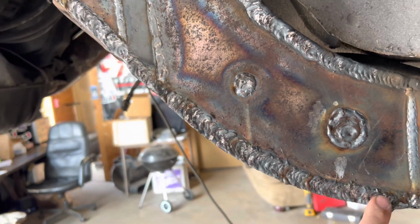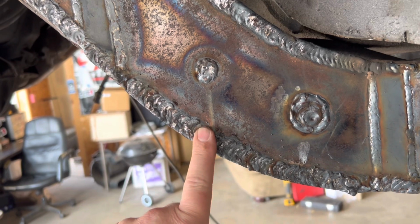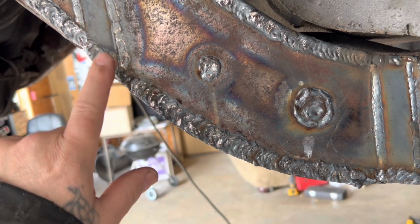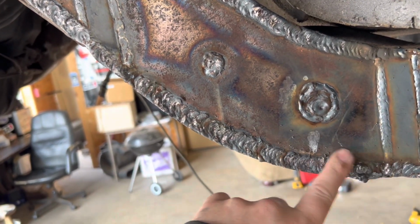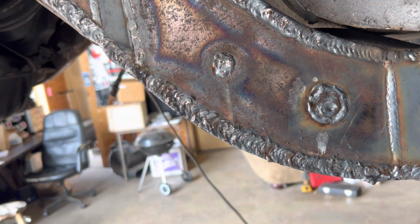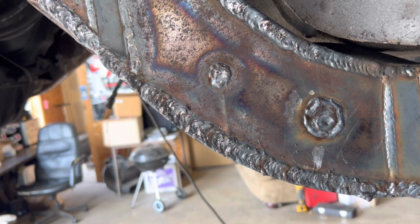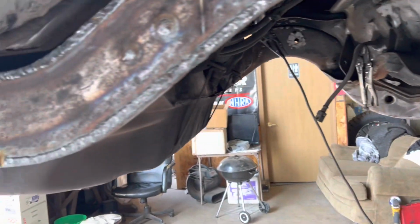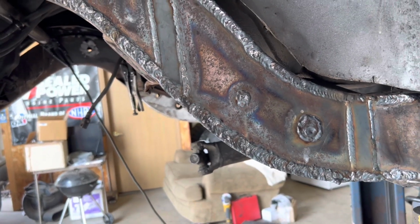So notching and stuff like that, I say with the back stuff, if you don't clean it up that good, weld your whole bottom first. I mean, it's still gonna get heat and it's still gonna drip, but clean it all up the best you can. When you're welding, obviously the cleaner it is, the better it is to weld. I see some people out there trying to weld stuff that's just completely rust or dirty, and they wonder why it's boogering up.